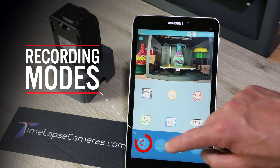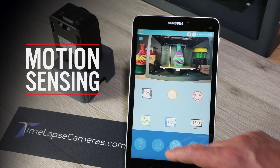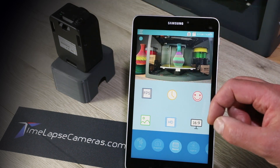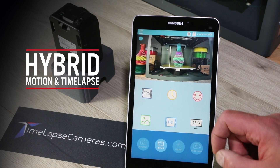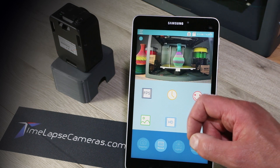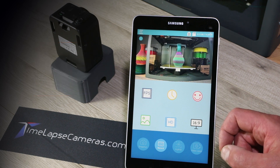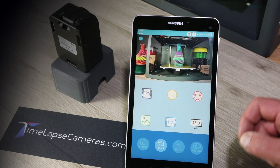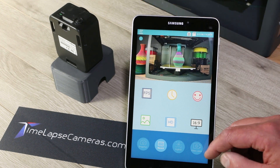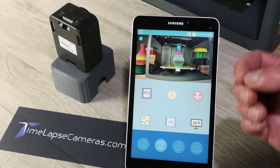Now the other record modes. PIR is passive infrared, which is motion sensing. Snapshot mode is for stop motion animation — if you start recording in that mode, you have to press the camera button to capture a frame. Hybrid is motion, PIR, and time lapse combined, so you can set up a time lapse every hour and also have motion detection when something passes in front of the camera. Video lapse is a more creative tool — rather than taking a single frame every so often, you're taking a burst of video every so often. With the burst length set to three seconds, every five minutes you'd get a three-second burst, building your time lapse with short video clips instead of frame by frame.